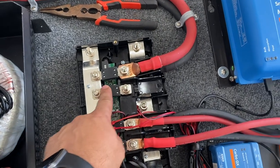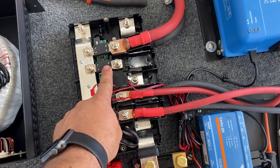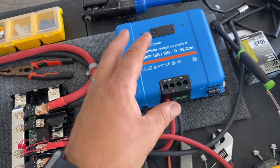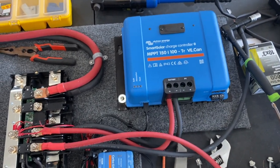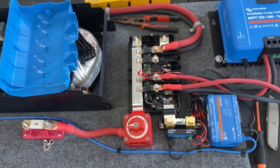You splice one of these in, heat shrink tube it all up, screw in positive and negative and you're good to go. I do have to put a dummy fuse in here otherwise a red light would show up. This customer is going to have an extra slot they can use for whatever they want, because we're using a giant controller — we're reusing the existing solar wire and we've got six panels going up there. A lot of work today, already pretty deep, no backing out now.